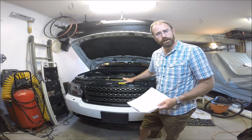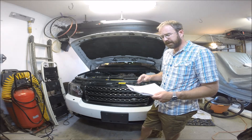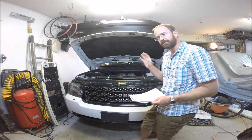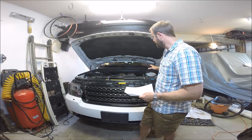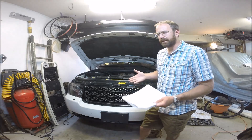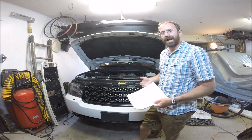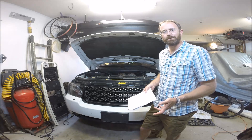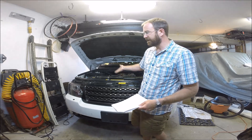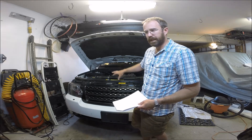There are also a few fault codes associated with this. But in general it's described as a rattle or click. If you hear a rattle or click on startup, that's a little bit normal — you'll hear that in the first half second after startup. But when this vehicle is idling, warm or cold, three to five minutes in you hear a rattle. It sounds kind of like a sewing machine — a clickety-clickety-clickety sound. What's happening is the timing chains are actually moving around and slapping, with play and wear inside the timing chain covers.